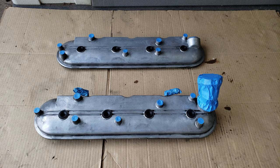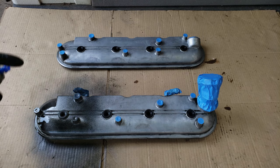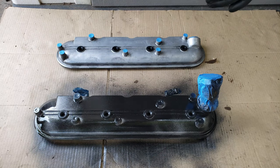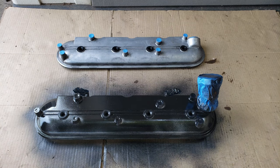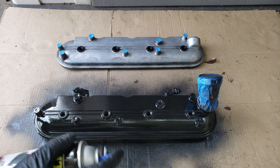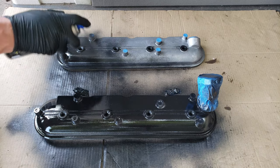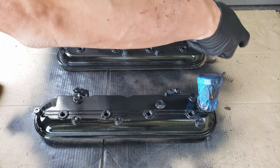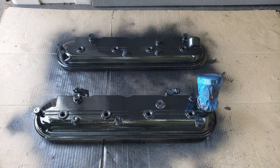Well let's go ahead and get started. I lay the valve covers out on top of cardboard, making sure to paint away from vehicles or anything you don't want to get overspray on. When painting with wrinkle paint, you want it to be sunny and pretty warm outside, and try painting in the morning or in the afternoon. I'm painting them at around 11am, so that'll give it at least 6 hours in the sun before it starts going down — good enough time to cause a wrinkle effect and allow for dry time. When spraying paint, you'll want to do a sweeping motion and don't want to focus on a single area, because the paint will saturate the area and create a run. So with this wrinkle paint, we'll do 3 heavy coats in a crosshatch pattern — our first coat sprayed vertically, or up and down. With our first coat done, we'll give it 10 minutes to dry before doing the second coat.